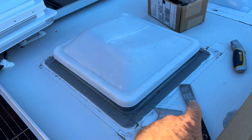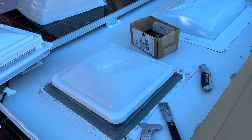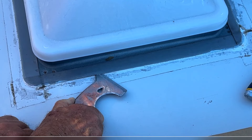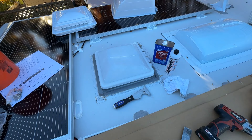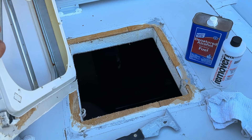Back on the roof - just so you know, the putty under here that holds it is actually a sealant that holds really, really good. It's hard to get this thing off. They didn't use screws but this sealant sealed everything really tight so it will never leak the way it is. I just worked my way around it trying to cut and hoping not to cut anything below. I've got solar panels all around me and a skylight so it's really tight to work in here.